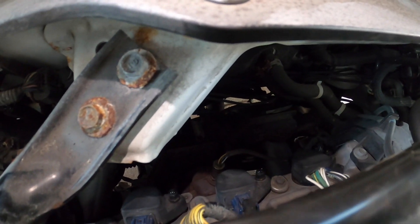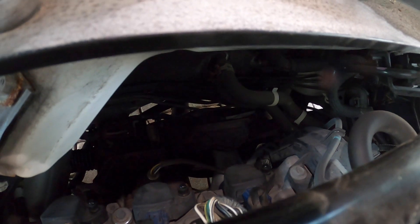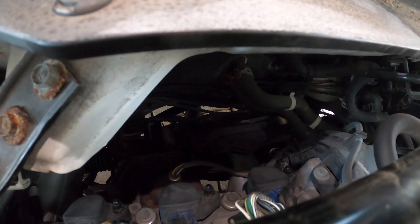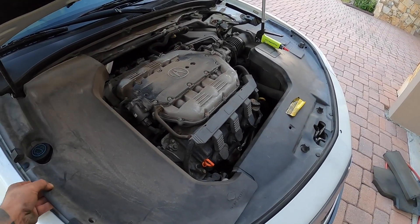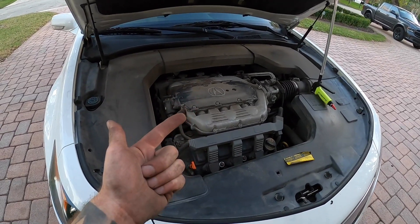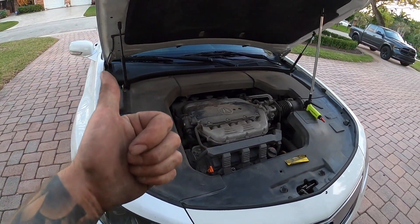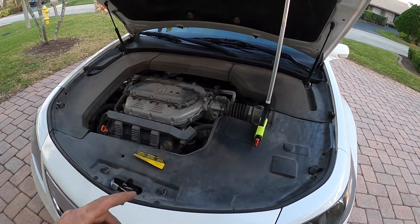You can see all three coil packs right there — they're not shielded by anything, you can see the 10mm nut and clip. All the way to the driver's side they're all accessible. It's not the most fun project but you can get to them with simple hand tools, and everything's tight. Put the covers back on — all the engine covers simply push back into place with the push pins. Everything used to get the job done, including the spark plugs and that socket, I'll link in the description below. If you enjoyed this content give it a thumbs up, check out the other videos — we've got a lot of S2000 content and other automotive content. Consider subscribing, thanks for watching!